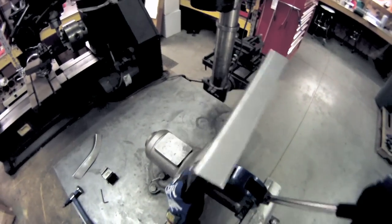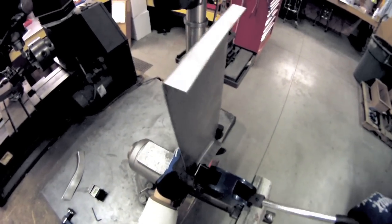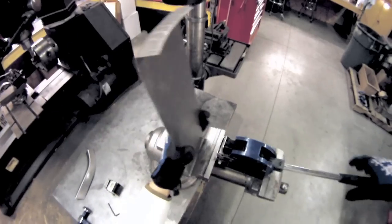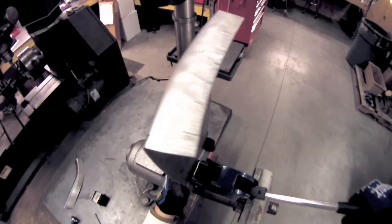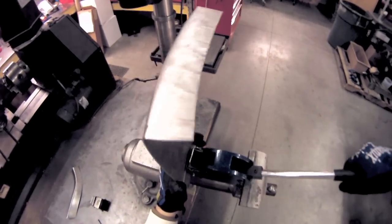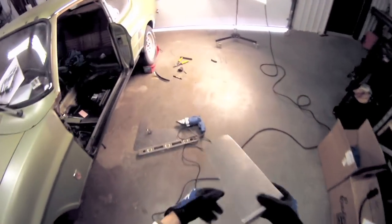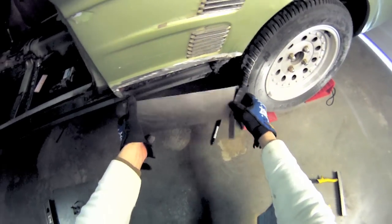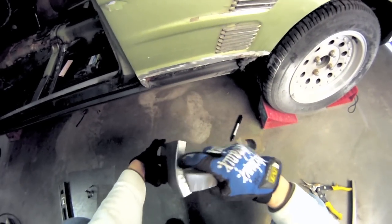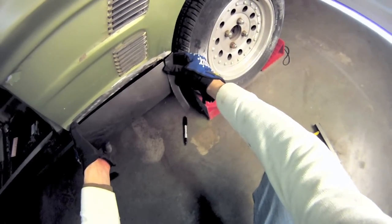This is a great tool — a must-have in applications just like this where we can't buy a quarter or a patch panel. For the price of this tool and a couple bucks worth of metal, we're going to have ourselves a nice panel. You can see what we're doing here — it's just bringing that in nicely, and the panel is then going to come down and mimic this contour. Now this lip here we're not going to use — we're going to remove that. We just put it on for forming. Now we'll hold it in place and trim it to fit.